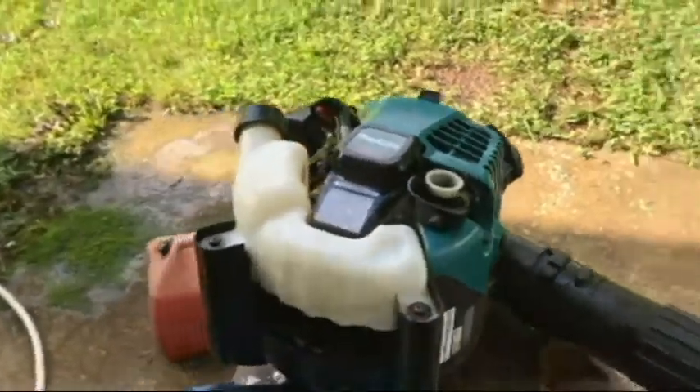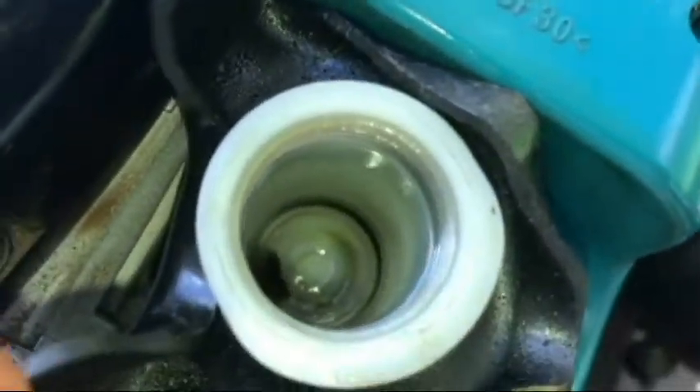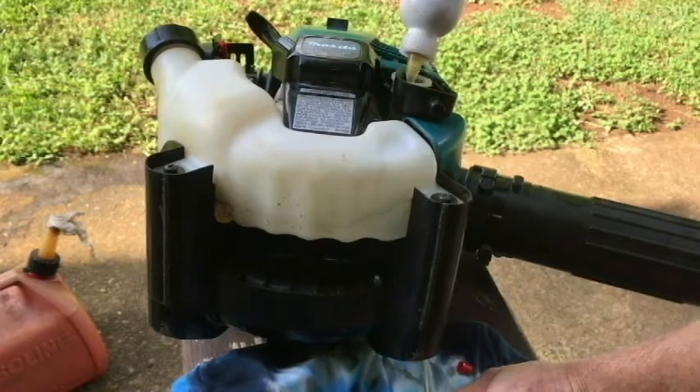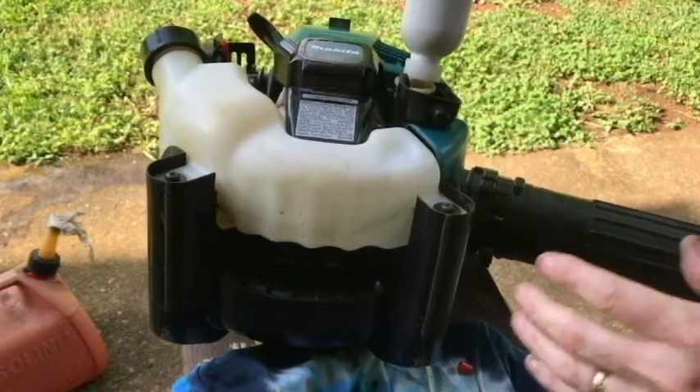I don't know if we're going to get that much. But I've got some prepared 10W-30 here — there's going to be plenty. I think this is like a 4-ounce bottle or something. So I'm going to add into the neck here. Again, 10W-30 is what they recommend. When I'm tilting it, the oil is actually going through where the dipstick hole was, and I'm just watching for it to drain right back onto that shelf.